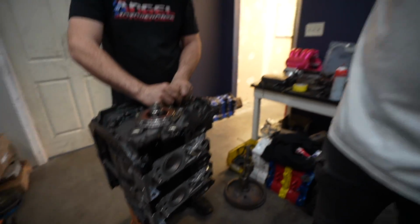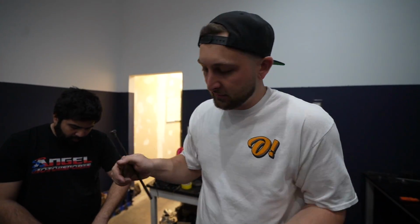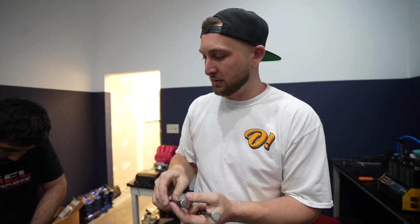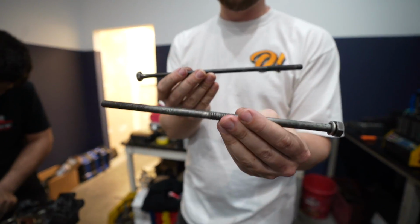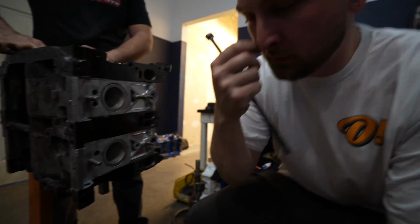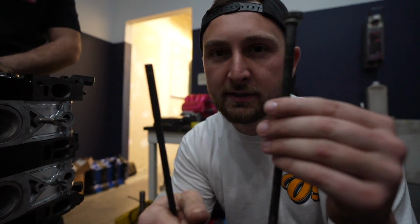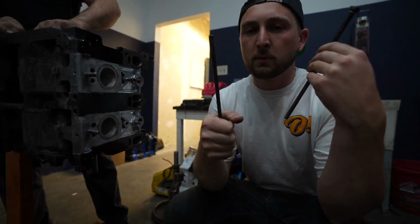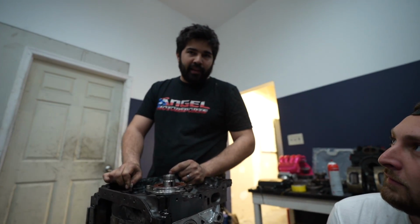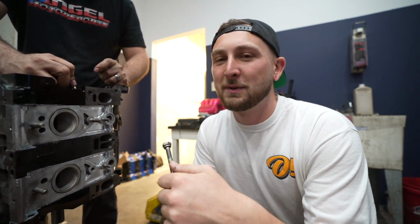We stacked everything up. Now we gotta basically bolt it all together because right now they're just sitting by gravity. Instead of having head bolts or head studs that hold the head to the bottom end of a piston engine, we have these giant bolts that actually squeeze all the plates together. And just like an engine, you could do bolts or studs. Studs, of course, will have a better clamping force, but unfortunately they're external, so they tend to lead to more leaking, which we don't want.